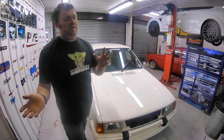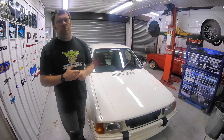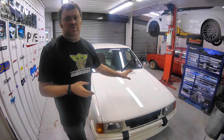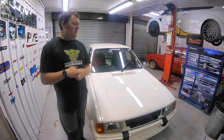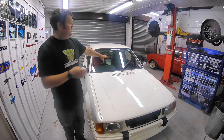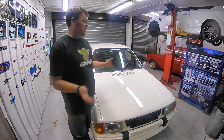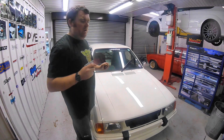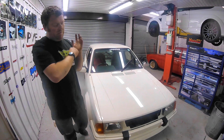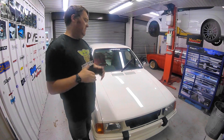We'll have all of the protection stuff that I like: oil pressure, oil temperature, lean - all of these things we're going to incorporate into the software of the ECU when we come to tune it. Initially, we're going to use as much of what's already been fitted as we can, and then wire that in. We're not putting the ECU up here originally where ECUs would be - this presently has two engine bay looms in it, so we're going to rip the lot out, rip the fuse box out, do it properly. I hate it when people add looms into these things, and I think the car deserves a bit of care and attention taken to it.